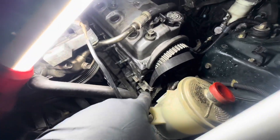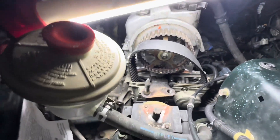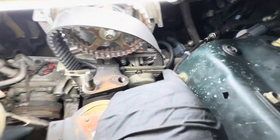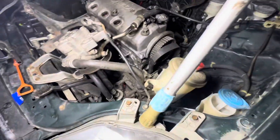I believe there are three bolts on this side of the cover — three on the left side looking at it from this perspective — two on the right side lower part, and then there's that top one right there. We also have to remove that bolt over there. Then you have the crank position sensor harness that you have to pull out of the way a little bit. Let's go ahead and take that crank pulley off and get started on the bolts for the timing cover.